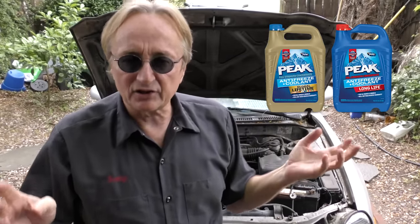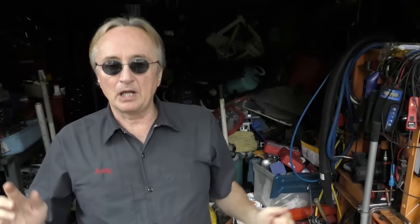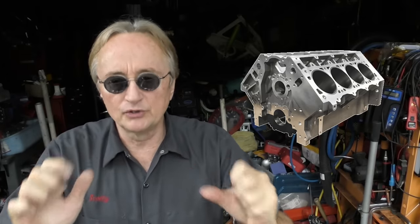Of course, you want to keep your coolant clean. Modern coolant lasts an awful long time — whatever yours is set up for, change it then. Some modern Toyotas can go 7 years or 150,000 miles before you have to change it. If you keep your cars that long like me, you have to change the coolant when it's time, because additives break down over time. And even though cars used to be cast iron and rusted, now they're aluminum — aluminum actually corrodes just as bad as iron rusts, and that corrosion will build up.